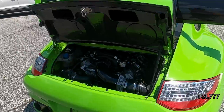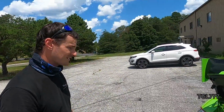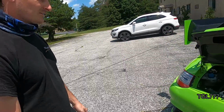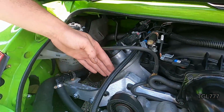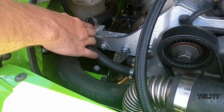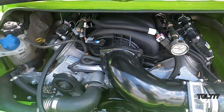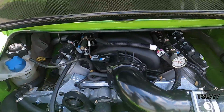But being that we want this to be a reliable track car, mechanical belt driven, you can't really get much better than that. So you cut just a little bit out of the sheet metal on the back of the car. The engine mounts, as you can see, bolt straight to the GM heads, and then right down to where the Porsche mounts go on either side. And they are rubber mounted, so it's not too crazy. It does shake the car a bit, but nothing more than normal.